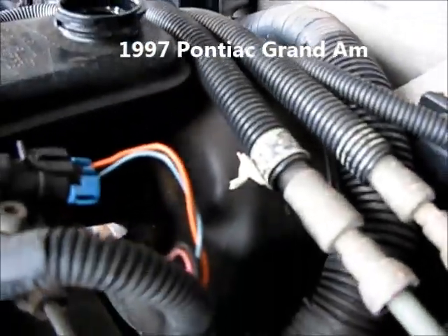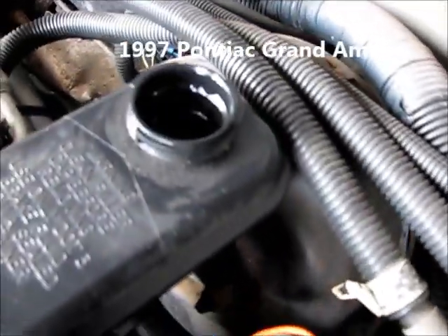So the problem began with a loss of pressure in the brake pedal. I did a little research, a little searching around this car. I found when we put some more fluid in that it started running out pretty much right in here. You can see this line is rusted, among other things, right about here. And it turns out to be coming into a small U-shaped brake hose going to the back wheel.